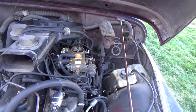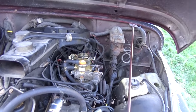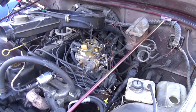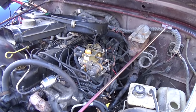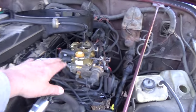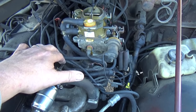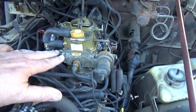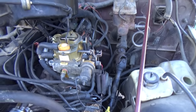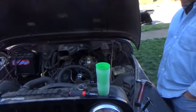This thing's been monkeyed around with by about three or four different shops, and it's actually squirting a little bit of gas out but it's messed up. So I'm going to see if we can find an older style carb without all the electronic garbage on it. My old CJ5 just had a manual carb and it worked great — I never had any issues with it. But when they were trying to meet emissions requirements, they put these electronic ones on with all the garbage. It may just be a bad rebuild too — it says Holiday Remanufacturing. But I think we could replace that with a standard one, or if he falls into a bunch of money, we could put electronic fuel injection in, and that would end all this crap.